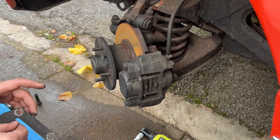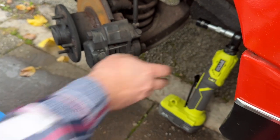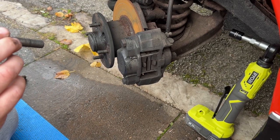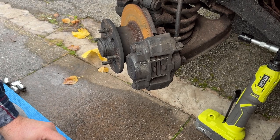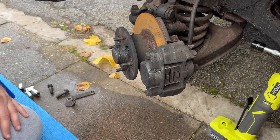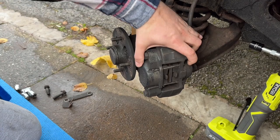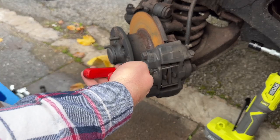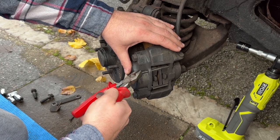Okay, so first step was easy enough. The new, not sponsored, but wish I was, Ryobi ratchet. Two bolts, and there should be a retaining clip on the back of this, but looks like whoever did the brakes last time let that part go on vacation. So they're quite simple, these. Caliper's loose now, but while it's in there, pull the pins. You have to flatten the pins off at the back. I love how easy these calipers are, he says while struggling with a pair of pliers.